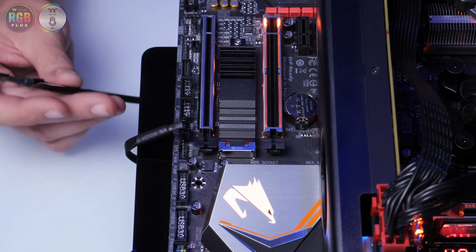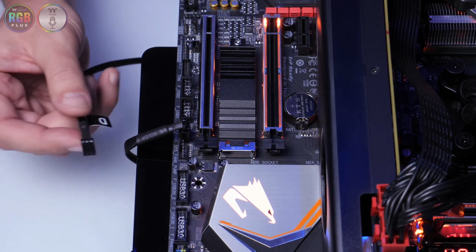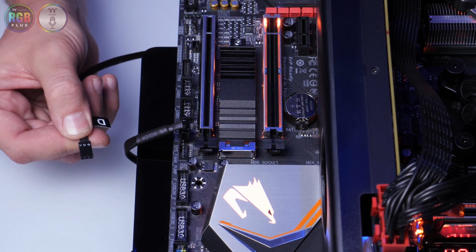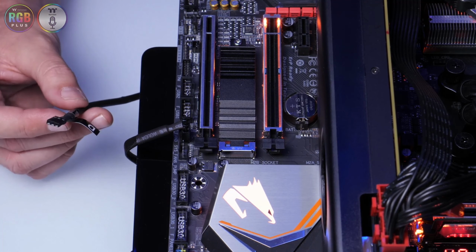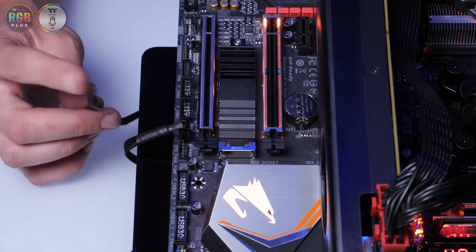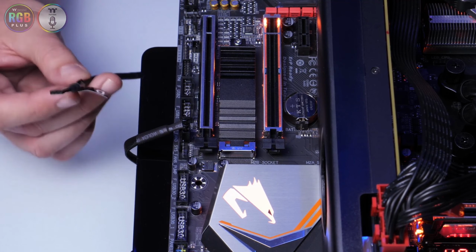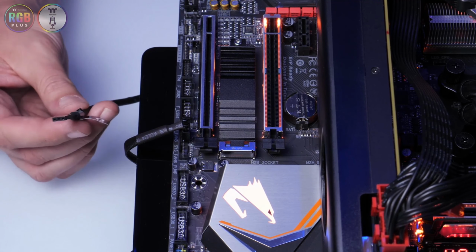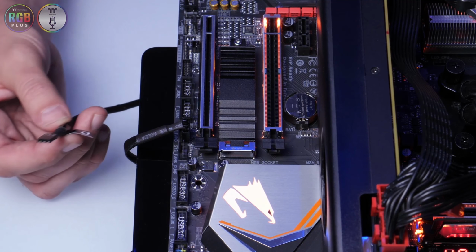Now with the sync controller, I'm going to be using cable number D for the data connection, as this one is the VDG cable connector for the Aorus motherboard. Now I've also been talking with Gigabyte closely, and they may be changing the actual header connector, but it will be changing over to cable C if they do so. So if you get the TT Sync controller now, you should have both cables in the box to make it easy to connect it up, regardless if they change it.